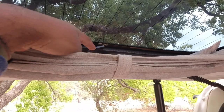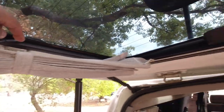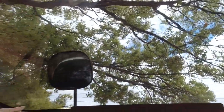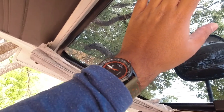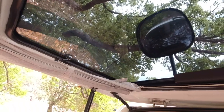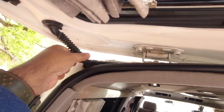When you're looking at the inside of the rear glass, make sure that the demister electronic connections are there and that they're not rusted through. A lot of times these will rust out. Also, the lines for the demister on the back, this one's got tint over it, but if your car doesn't have tint, make sure that all of the lines are intact, because if you clean it quite roughly or harshly, these are electronic connections and you can basically break those connections and then that line won't demist your window in that area.